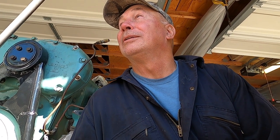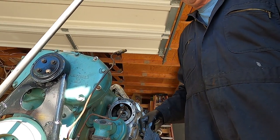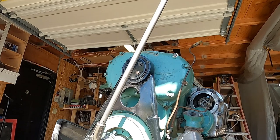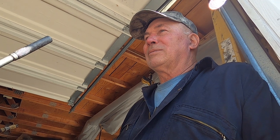We actually found some rod bearings in there that were installed correctly — amazing. Well, it didn't run long enough to hurt it. He's saying we need to get this engine into a machine shop and hone it out to ten over. I can see if we can find fives, but let me get the rest of these out and we'll have a talk about parts and pieces. I'll explain why some of this stuff isn't going to work — I'll show you the pistons and why they don't work later.